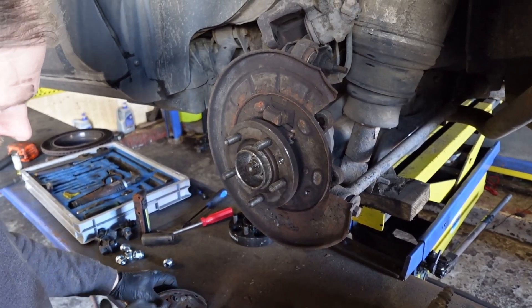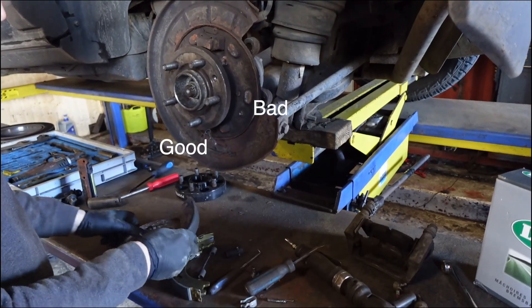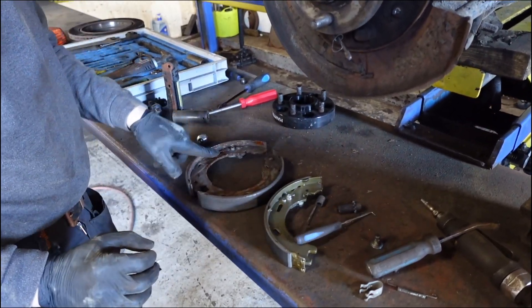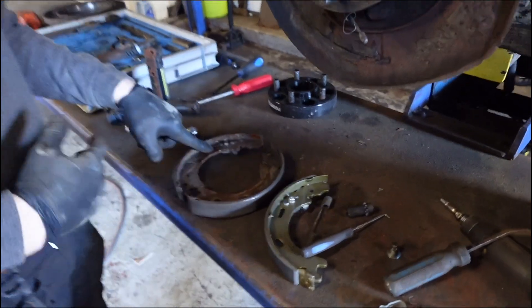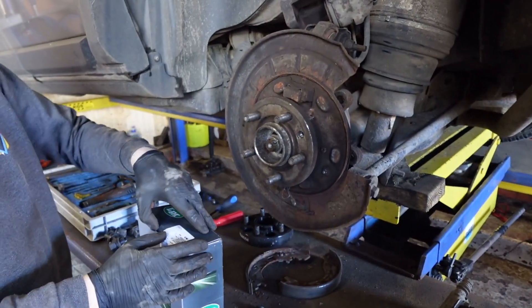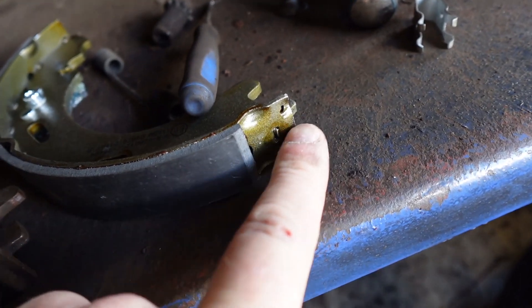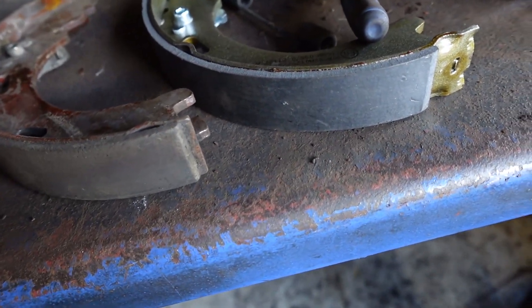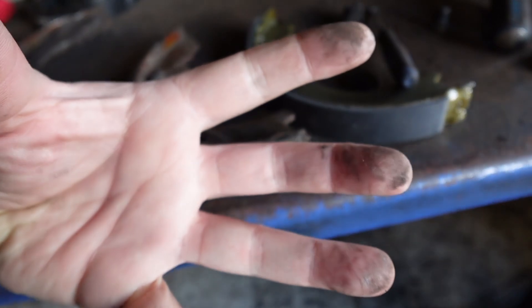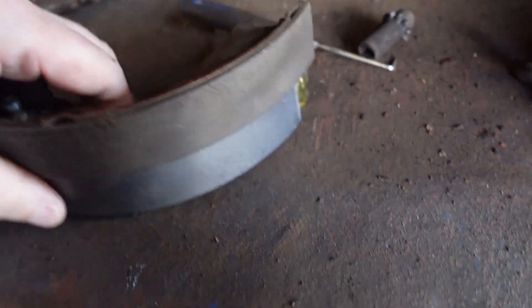What they do is they put too much brake lining on the tops. Sometimes that hole is just round — a round hole — not slotted, which makes them a nightmare to fit and you can't get them to adjust right, and everything just goes haywire. What Dave is telling me is, look at the difference — how much meat you've got there on the shoe remaining versus meat right to the edge. As he expands it, you're getting an oval created, so you're getting a high spot and a low spot that's touching more, and that's what can jam on.